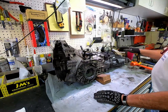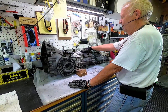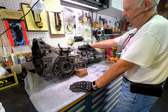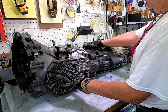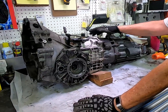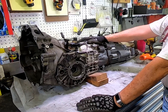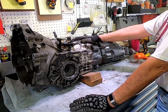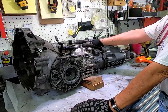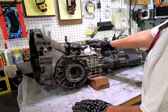What we have here is an O1E transmission. This is one of the last years — it's out of a 2003 A4 V6, commonly called a B6 A4. This is a GBE transmission. In 2002 it was called an FYF. You might be able to find some of these GBEs on a 2004 A4, but they're rare. The main difference between this transmission and an FYF is a speed sensor.